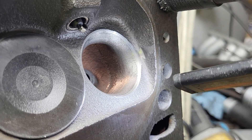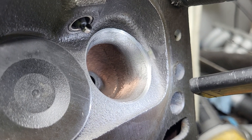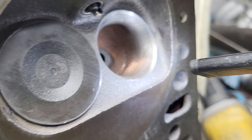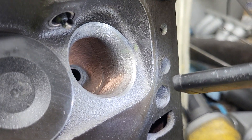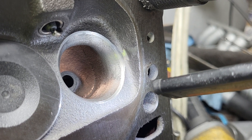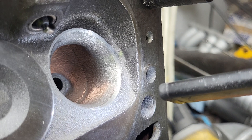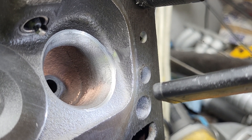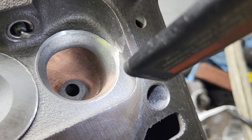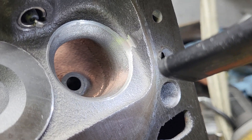Alright guys, part 2 of this throat experiment with this exhaust. Now this is a swirl port head. The exhaust port is an end exhaust port. The first cut we did, we just put the bigger valve in and sent it. All I did this time was a quickie radius job, similar to the recent video I did that a lot of guys liked, on a completely stock port. Next we're going to shape that whole port and see what it is.